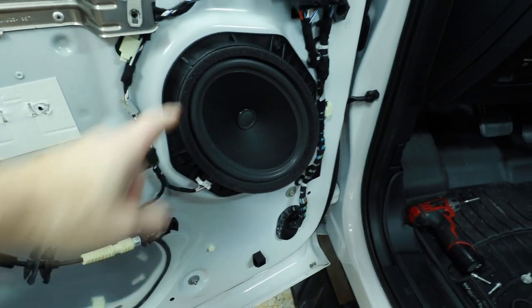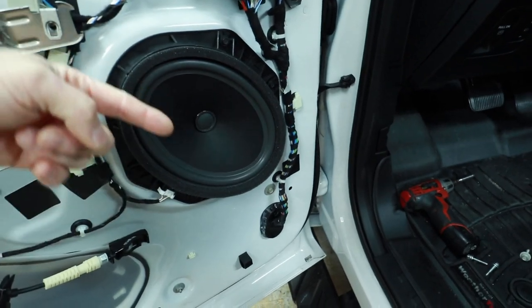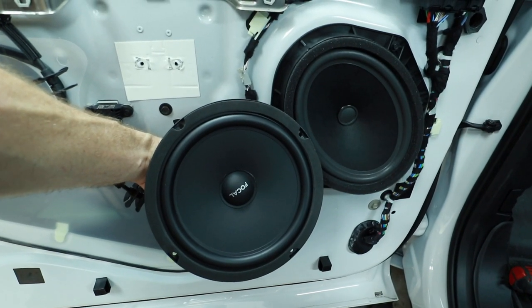Now, what is the plan for this speaker? We're working on an F-150. What we're going to do is replace the factory 6x9 with the 8-inch woofer, making a new panel for it. This particular speaker location is extremely wide, which is perfect for an 8-inch. Now not all 6x9s can be swapped out for this 8-inch — you do have to have a wider area in order for it to fit, but some of them you can, like this one.